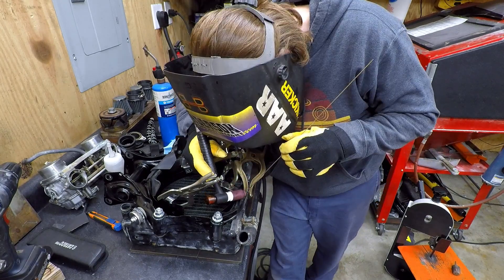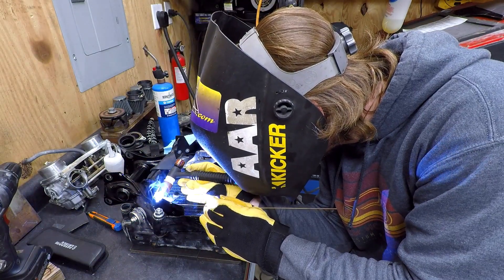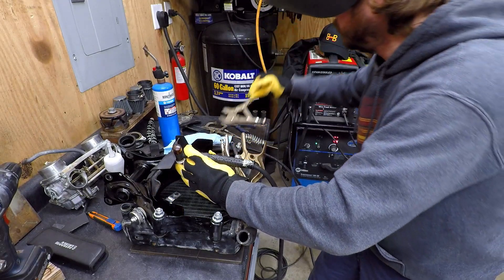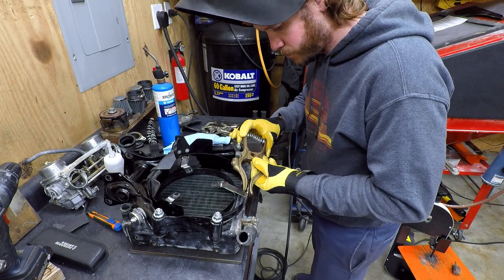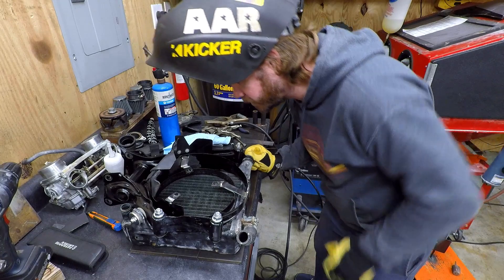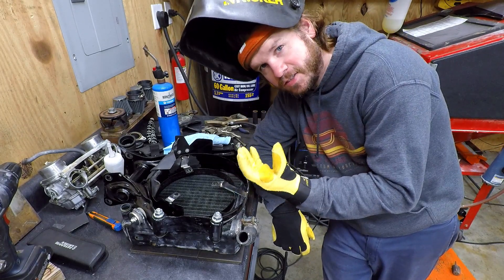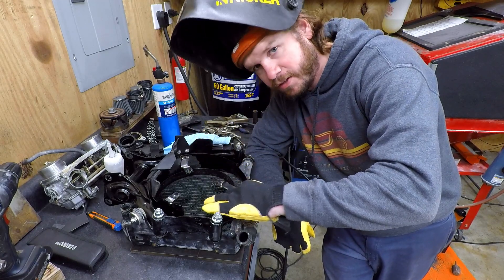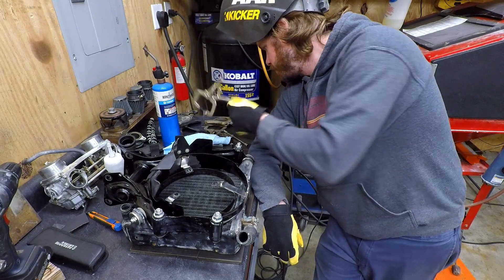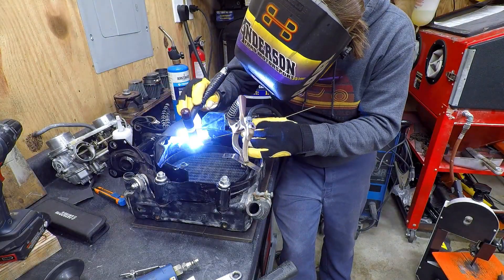Look at this — that back cap is already coming in handy right now. We are all tacked up. One thing I'm a little concerned about is removing all of this and then using my ground clamp somewhere — it has so much tension it could distort this whole thing. This is only just thin sheet metal, so I'll be careful when I'm clamping it, probably use my smaller clamps and ground through this. But yeah, I like the fitment. I like the location. Pretty excited about it. We'll see you next time.